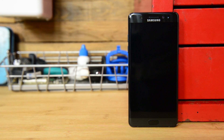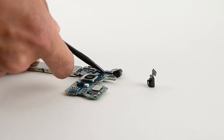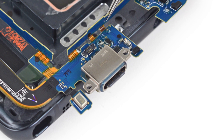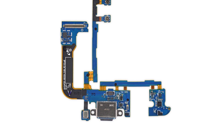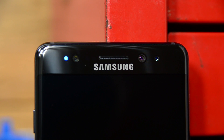And last but not least, the Galaxy Note 7. In the Note 7, you'll find a newly designed S Pen that won't get stuck backwards in your phone, along with iris scanning technology and sealing gaskets surrounding the modular headphone jack. The Note 7 scored a 4 out of 10 on our repairability scale. On the upside, the sealing gaskets contribute to the Note 7's IP68 water-resistant rating. Modular components and improved cable routing means many components can be replaced independently, but front and back glass make for double the crackability, and due to the curved screen, replacing the front glass without destroying the display will be nearly impossible.